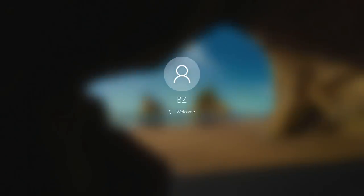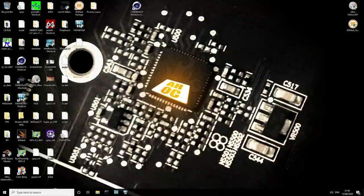And it just crashed again. So again, we have to lower the ratios and run Prime 95. At this point, I feel like this is the end of the video because there's not really much to it other than just lowering the clock speeds. And what I would lower first is CCX1 because that's the highest clocked one, so it's probably the one that's crashing, or at least that's what I'm assuming.